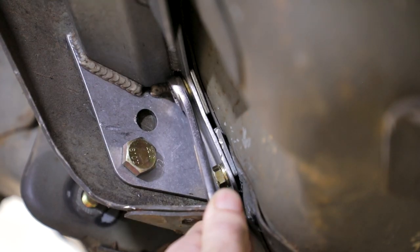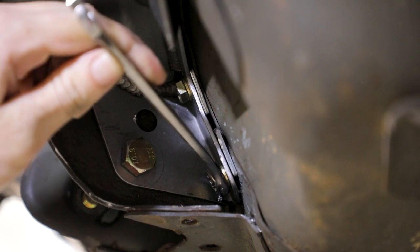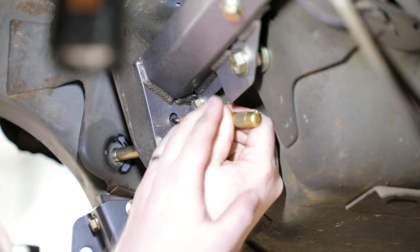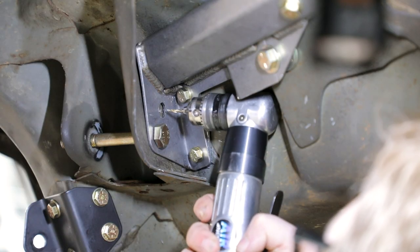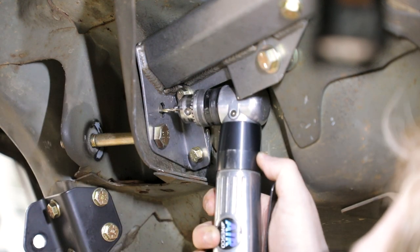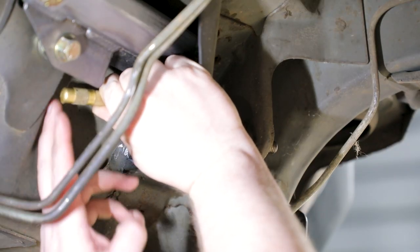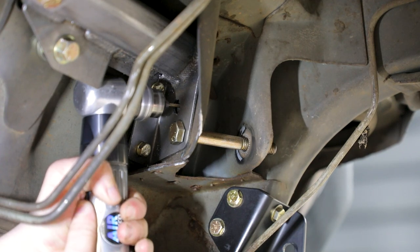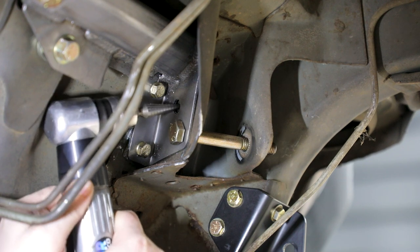Tighten all four 5/16 bolts. Use a snap punch to locate the center of the upper hole in the upper link weld assembly. With a 90-degree drill and a short pilot drill bit sized to reach, drill through the inside of both upper trailing arm pockets. Using a unibit, drill through the pilot holes on both upper pockets to a final size of a half inch.